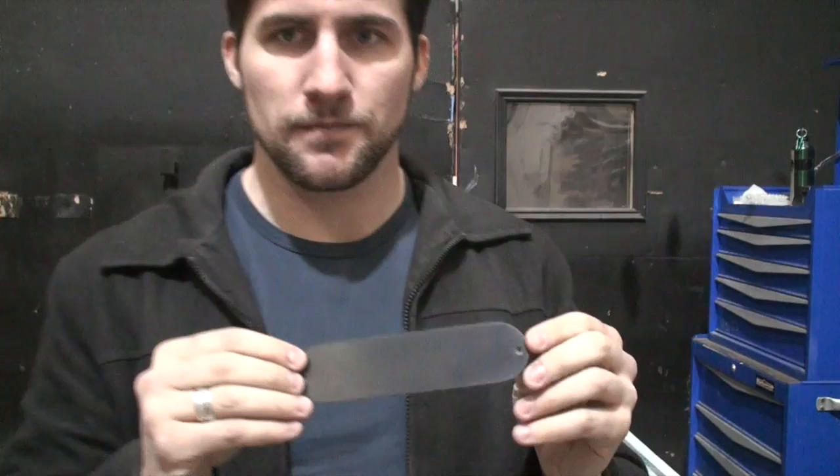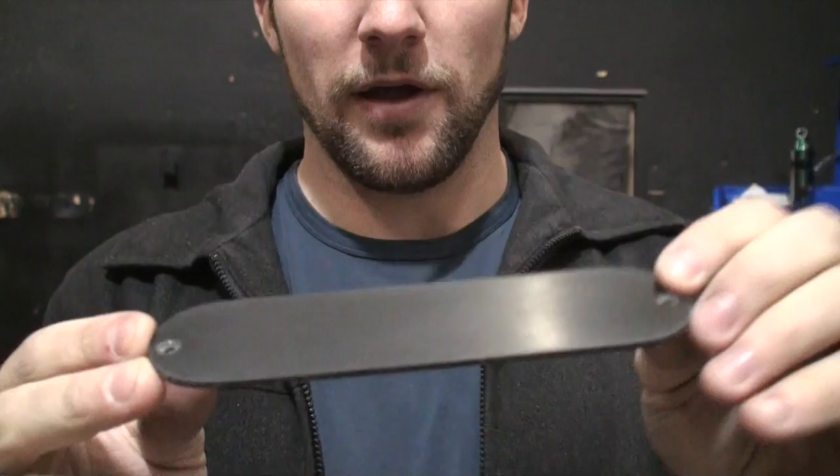For that reason we need to take a couple of extra steps when painting plastic. The first step is nothing new — if you've watched my videos you know that you need to scuff stuff before you paint it. I'm using some gray Scotch-Brite and making sure I've taken all of the gloss off of this piece of plastic so that the paint can bond to it mechanically. There's got to be something for the paint to grip onto. The piece now has a nice matte, scuffed-up surface.